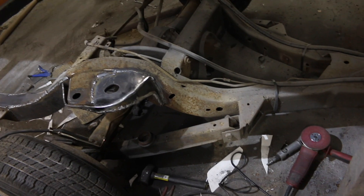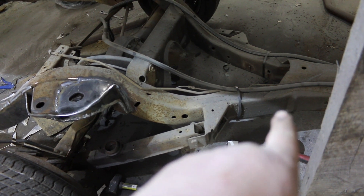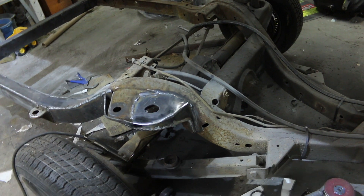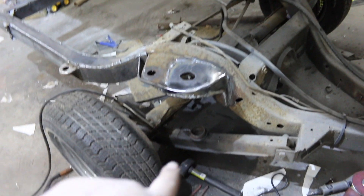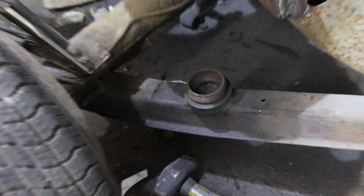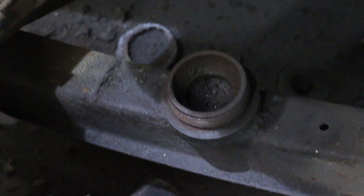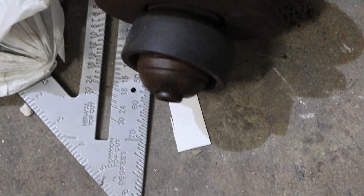I've got a long ways to go. I'm gonna relocate the rear trailing arm brackets up and make a wishbone for the back end — take out the banana bar, put the wishbone in. Probably get some new powerballs too; the ones I have are kind of old-school looking with a hole down in them. The ones I got from Black Magic are all the way smooth on the powerball itself, but with a top on the end, which is kind of different.